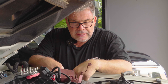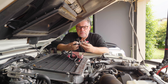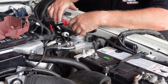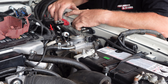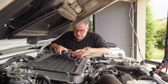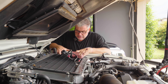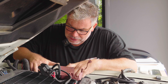With all the wires out of the way I managed to get that accessory box off. Now I want to work out where to put the two bus bars. There are some tapped holes on the side of the cruiser already so I might reuse a couple of those. I'd really like both bus bars positioned here so I can get the cables straight in, lose a lot of length off the cables, and reduce voltage drop, weight, and improve cleanliness. I just need to work out how to run neatly from the battery to here.